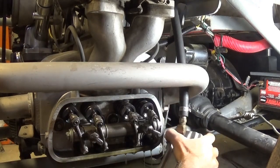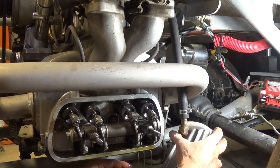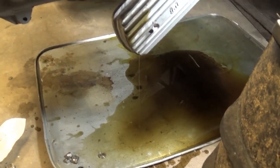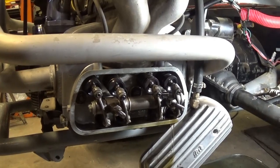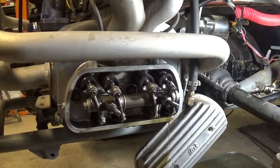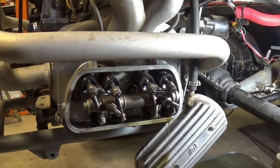I'm just going to set these back out of the way. I'm not even going to change the valve cover gaskets — I'm going to take some with me. Look at all this oil that came out of there, and it's still coming out. That's because we overfill them, because we're at odd angles when you're driving around those dunes. You don't want to be running without oil — your oil is only going to circulate if it's got the pickup in the sump.